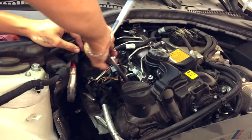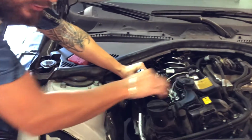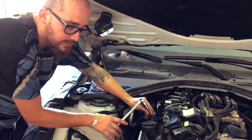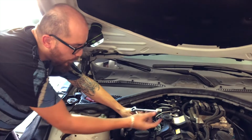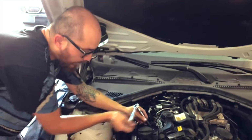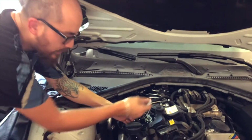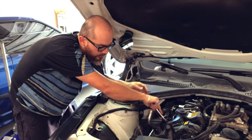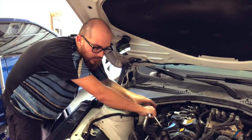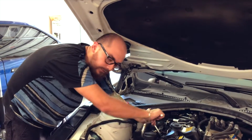Now when tying this up, this is very, very crucial, to make sure that you torque them at the right amount of torque. There's a tool specifically designed that tells you what torque you are at. It's called the torque tool. I don't carry that, but I know for sure what kind of torque I'm looking for. Because you don't want to just hand tighten them because the plug expands. If it expands, now you have a probable cause of a loss or a misfire to happen.